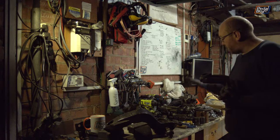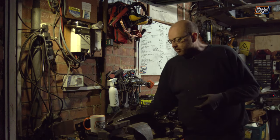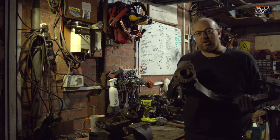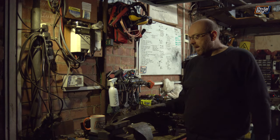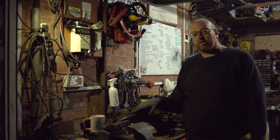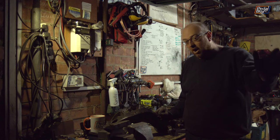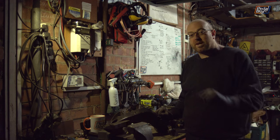We've already disassembled, as you can see from this massive pile of parts, all of the suspension and brake components from the front and rear hubs, and it reminds me just how terrible these things are. The unsprung mass on these trailing arms is absolutely horrendous — these things weigh about 25 kilos all up with the discs and calipers on. If there was something I could change, I would almost certainly build some box section trailing arms, but that's something for the far future once this thing's actually done and driving.